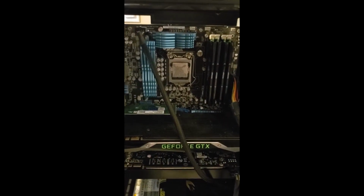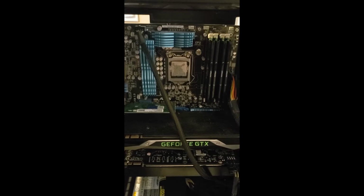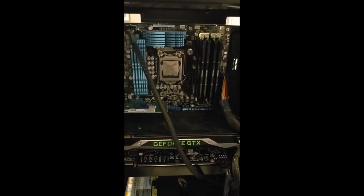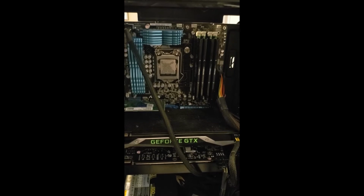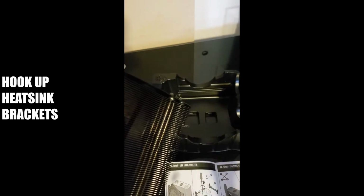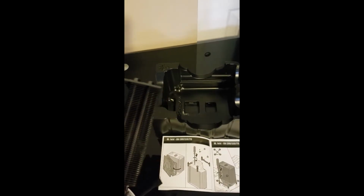So next up is showing putting some thermal paste on the processor, and I already have a little bit of Arctic Silver on my processor, so I'll just go with what's already there. It's kind of smeared around quite a bit. It's probably more than needs to be on there, but I'll leave it as is for this first go around. So we're now back over to the other side, and now we're working on, I guess, assembling the heatsink, or assembling the brackets to the heatsink.